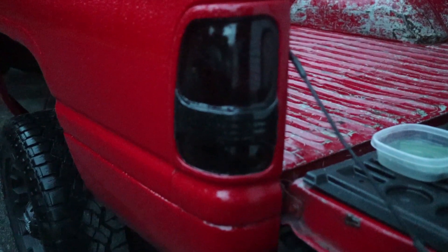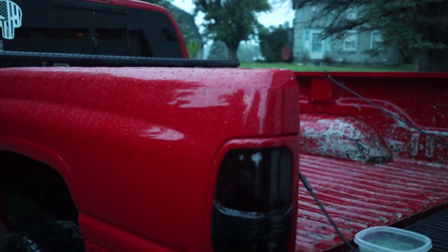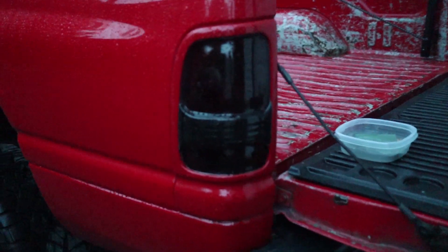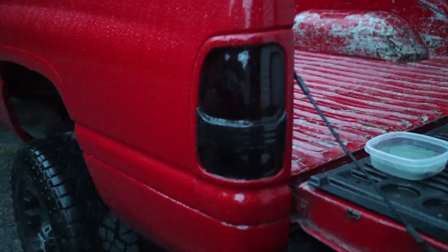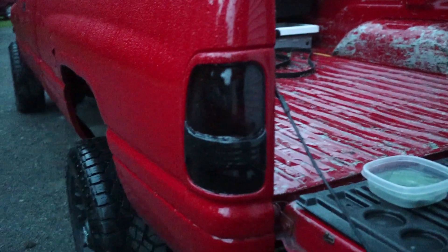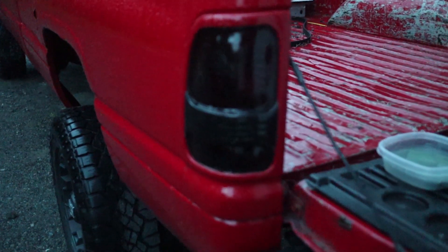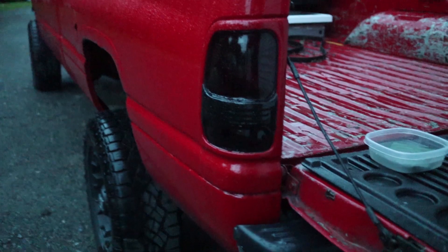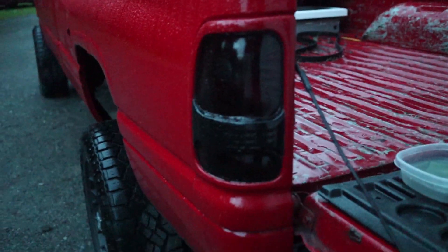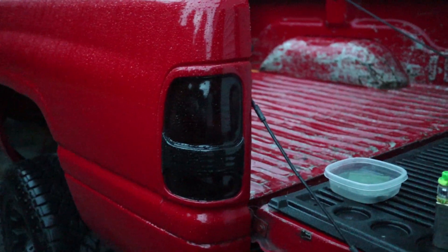We'll go back over it with 800, 1000, and 2000 grit sandpaper for a light wet sand, then out comes the rubbing compound and polishing compound — the same exact steps as the previous video. Get a good look at how dark that one is compared to the other one. With the fresh color match, there's nothing to color match on the third brake light — it's just a small lens we get to tint so it matches the two. I got home from work a little late, it's around eight o'clock, and it started downpouring as soon as I got here, but I said I've got to get this done.